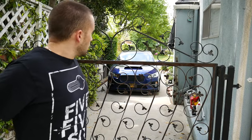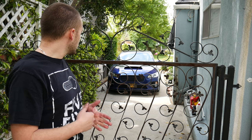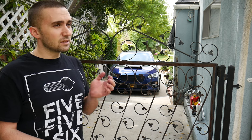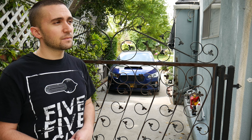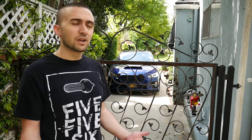Finally done with that install — it was a pain in the ass. Definitely don't want to do that one again. There's the heads-up about bleeding the clutch — it's a very tight space to work with, especially with the nutserts, getting everything torqued down and all the little attachments. I just got back from a test drive and the clutch pedal feels the same to me, but aggressive shifting from first to second is a lot more stable — there's a lot less drivetrain flex. It's very smooth. It's mostly for preventative purposes in my case. If you guys have any questions, leave them in the comments. Make sure you subscribe, give this video a thumbs up, and I'll see you guys next time. Peace out.